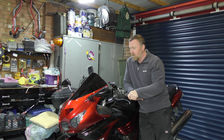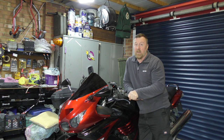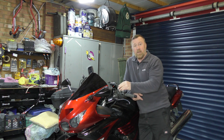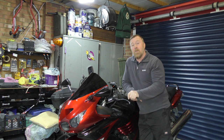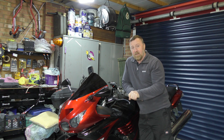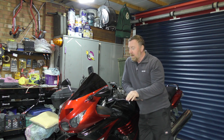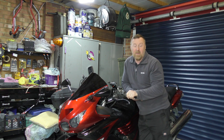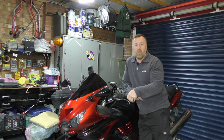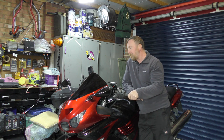There are some horrible things and some lovely things. This bike has not been serviced or really on the road for four years. The clutch fluid was just under the limit, the brake fluid looks like old dirty beer, and the rear brake is spongy. All the hydraulic fluids need changing. Coolant was negligible and under the limit. The tires were both low. Fuel was nothing — it's stale — and annoyingly the garage had no super, so I had to put horrible E10 in.